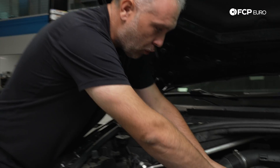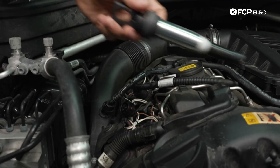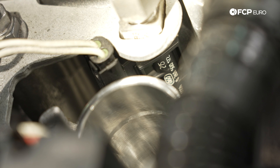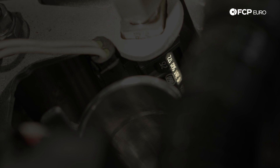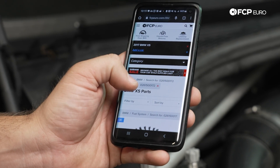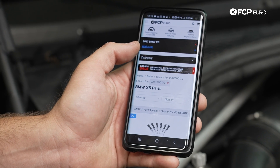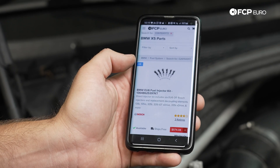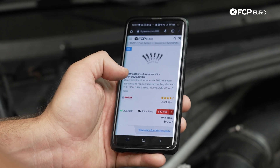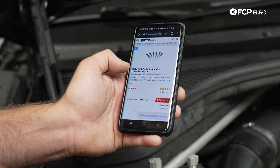First and foremost, we're going to pull out the ignition coil for cylinder one. On the side of the injector, there's a bunch of writing. All of the white writing on the injector is what you need to look at. One of those numbers is going to be a 10-digit number — that is a Bosch part number. I entered the Bosch number off the injector, which is 0261500172, with a 2017 BMW X5 xDrive35i selected. The first thing that pops up is the EU6 fuel injector kit — which is what we need. The scan tool said EU6, and the Bosch number off the injector also points to EU6. Therefore, we know for a fact that this car has EU6 injectors.